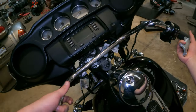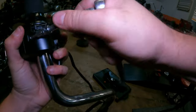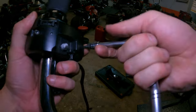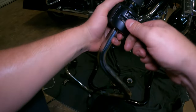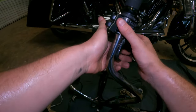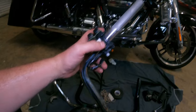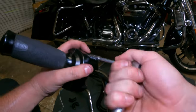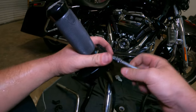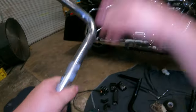Now there's a set of bars. If you have a 2019 Street Glide or anything pretty much 2016 and up, you're in a really good spot because these are the easiest bars to do. There are a couple little tricks but I'm about to show you — it's really super straightforward. Take the shells off your bars. To get the trip switch off you just pull up and pull out. Grip comes off. This is the clutch side — you might need a little pick. Clutch side's off, same thing on the other side. Once you've got that off, the front side comes off too. You can do this on the bike, but it's easier in my opinion to do it off the bike since they're coming off anyway.